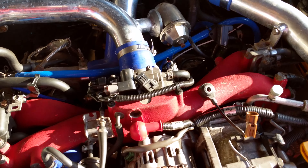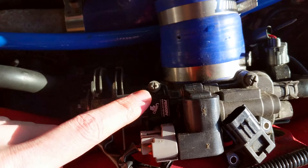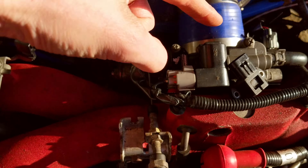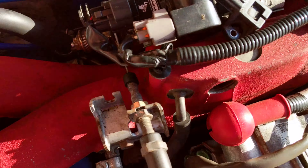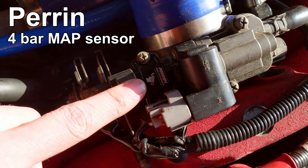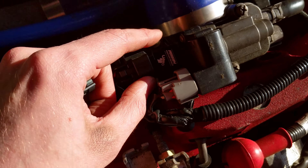The last two sensors I've got to change before the remap is the MAP sensor, which is this one. If you're still running a top-mount intercooler, your top-mount intercooler will be here next to the throttle body. And the throttle position sensor is down there, don't need to worry about that, it's okay. This is an unscrew, and this is the stock one I've got in my hand. Two screws, one plug, goes in there. However, I recommend absolutely leaving this in place until you're on the dyno, basically ready to get mapped.